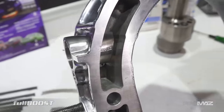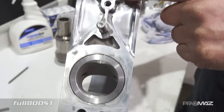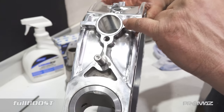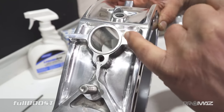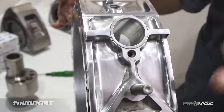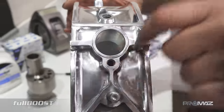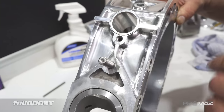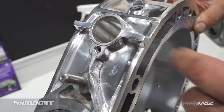From here it looks factory — it's a beautiful setup, very nice finish. We've tested it to probably 75 to 80 psi — it actually bites into the gasket. There's no O-ring. So it's as per the factory gasket. A lot of people put an O-ring and a gasket together and it creates all sorts of problems. We've found this design to work the best for our needs.